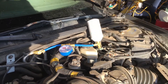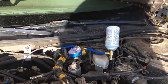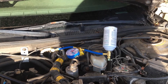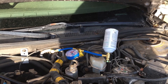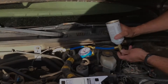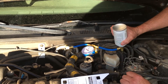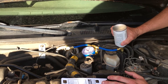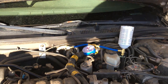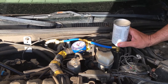I'm going to start the car — not catch it on fire — and run it a while to keep that pressure around 30 to 38 psi. I reopen the valve and watch the gauge go back and forth around 35 psi. The vents aren't overly cold at the moment; the compressor's running and you can hear it cycle on and off. Still not super cold.